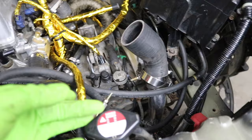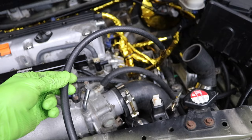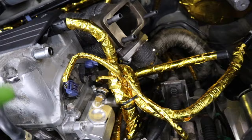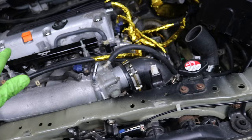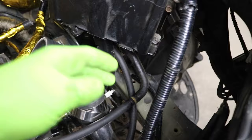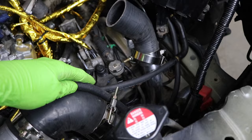We are getting real close now. I got a quarter inch EVAP line run for a vacuum line — not sure yet if I'm going to run this or if I'm going to pick up some actual quarter inch silicone vacuum line. But this stuff is pretty thick and I gold heat taped it where it goes onto the wastegate. That's just on the lower nipple of the wastegate — I got to get one more on the top nipple but I only have this one hose so I got to pick more up tomorrow, so we're not doing that in this video. What we did do was build our little check valve. It works out perfect that that 90-degree bend is there, and I think our battery tray is going to sit over all this — so it should tuck nicely under our battery tray and come up to our throttle body following this intercooler pipe.